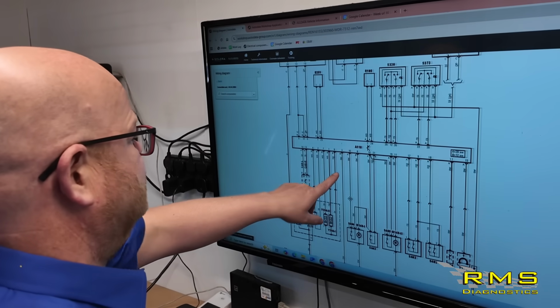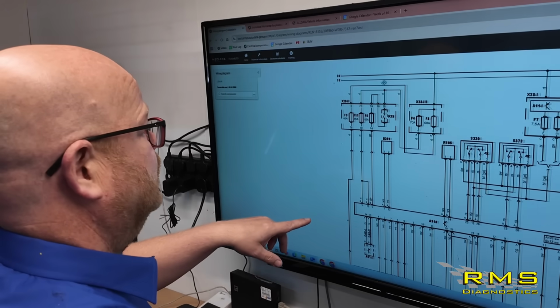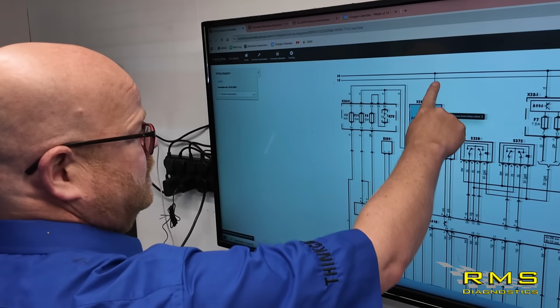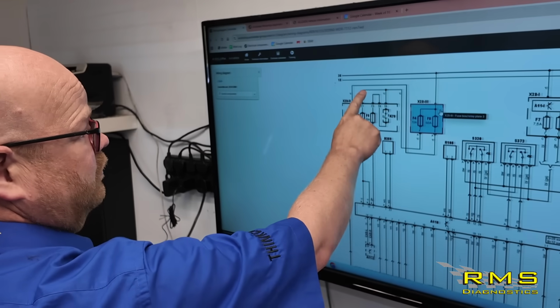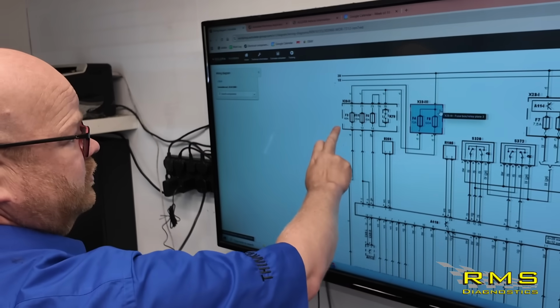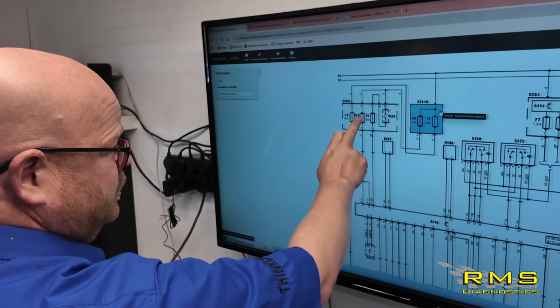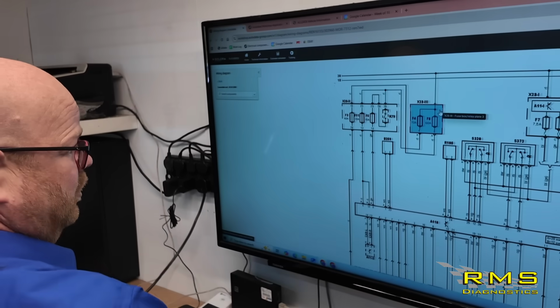We've got a main live in on pin 3. We've got a battery voltage, so terminal 30 is battery, through fuse 4, 70 amp, comes through, tees off and drops down to fuse 11. This is a fuse box inside the car, so fuse 11 gives main power, not switched, directly down there on pin 5 and pin 12 on the big red wires.